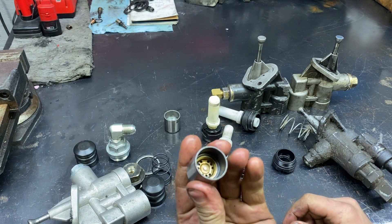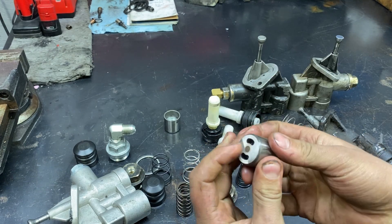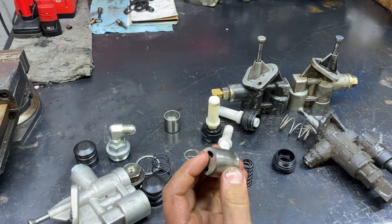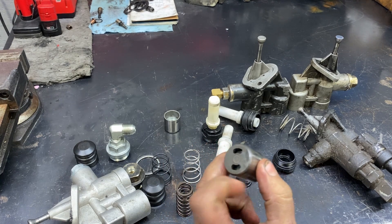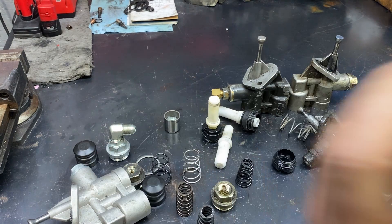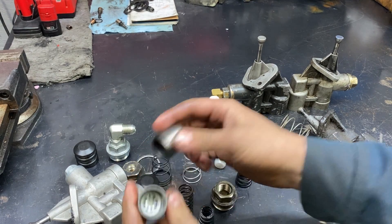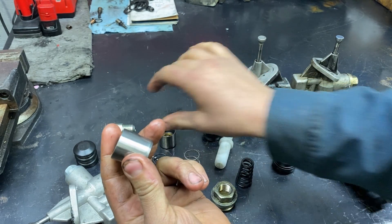Here's another plunger. The plunger can allow fuel to go in one way but not the other. When they go bad, somewhere inside this valve mechanism, it will not hold prime or it will take a while to build fuel pressure. One of these did fail — it's letting pressure past the wrong way instead of only one direction. I can blow on it to test. This one's good; this one kind of lets some pressure by. There are a couple of different variants — most have just three holes, but this one looks like it has some bigger holes, so it might actually flow a little bit better than the others.